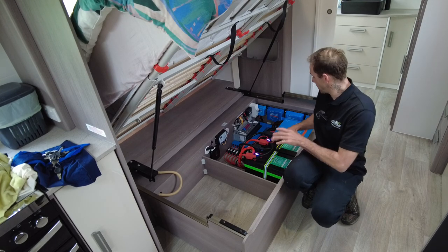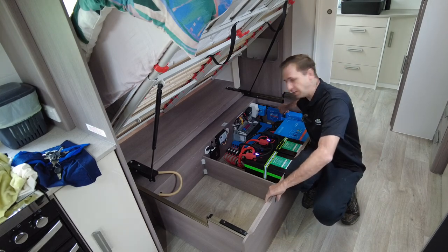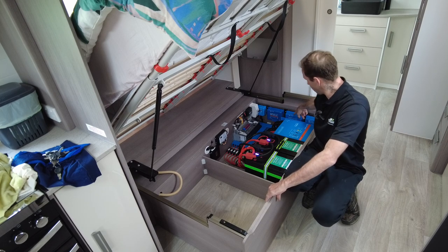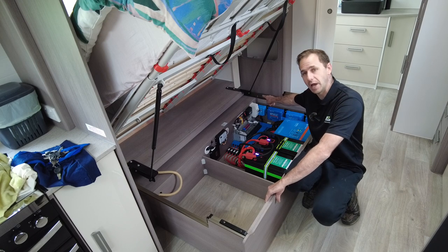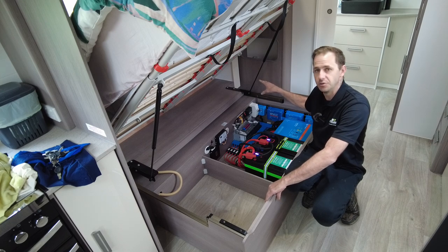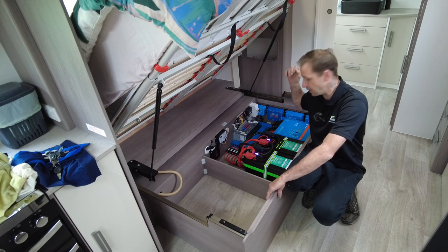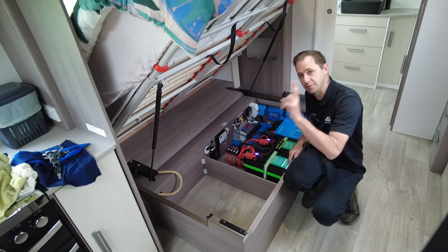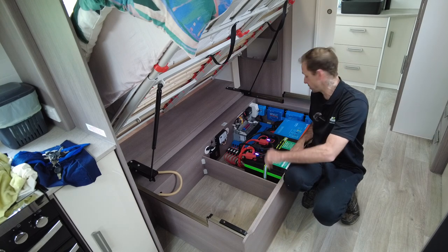Very cool. As you can see, we've gone for all the Victron fruit on this one. We've gone for the 30 that's now programmed up, the 5100 that's now programmed up, the Orion 30 that's programmed up, as well as the little 2100 that's programmed up here. These have the ability to fast charge this system. We've got 1120 watts on the roof here. We've gone for four 200 watt panels and also two 160s. That's all taken care of by the smart solar controllers down here.